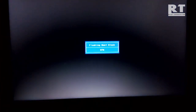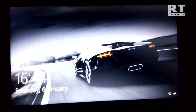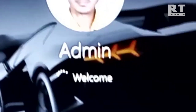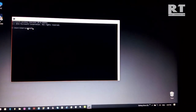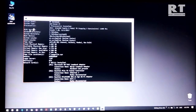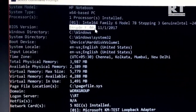Let's see. The Windows logo appears on the screen and now we can log in to this PC. Once the computer is logged in, go to the start menu and open command prompt. Type system info and check the current BIOS version. See — here it is: F40. So this is the updated BIOS version.